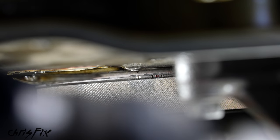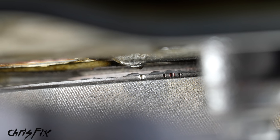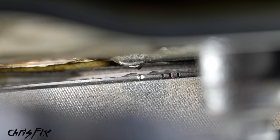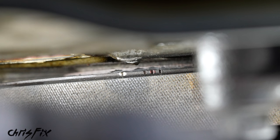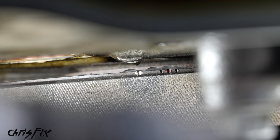You look all the way down to the crankshaft pulley, and you can see on the engine block is a little arrow, and that needs to match up with that white timing mark on the crankshaft pulley, and you can see it matches perfect. Now, hypothetically, if your timing marks don't align perfectly, maybe they're off by a couple of millimeters like this, your timing chain could have skipped a tooth or it's worn out and needs to be replaced. But in our case, we are spot on, so we're good to go.